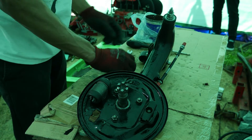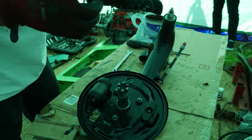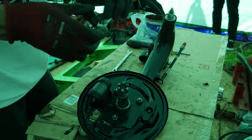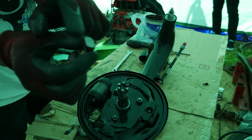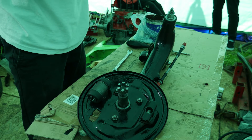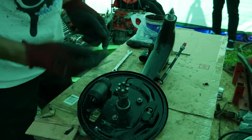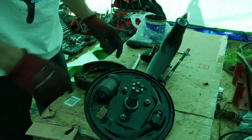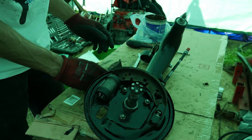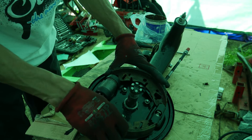So that's done now. I'll take these little cam pieces, slap copper slip all around all four sides, and then slot them in. It's obviously a tapered angle to match the taper on the actual cone itself. Now we'll look at fitting the shoes — this is the passenger side, so this is the correct orientation for the drums on the passenger side.